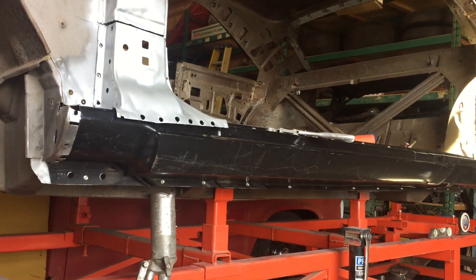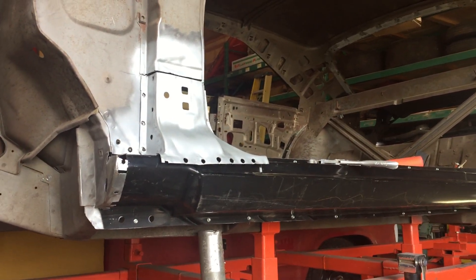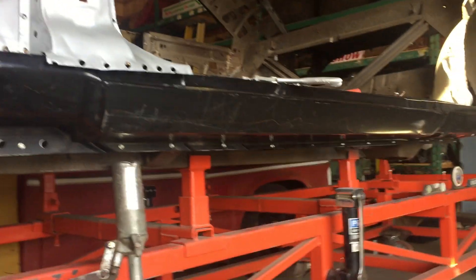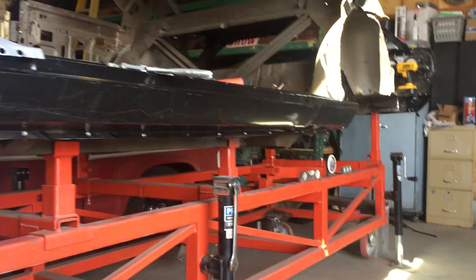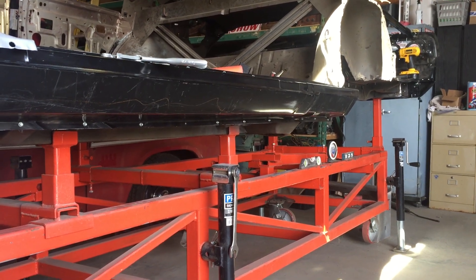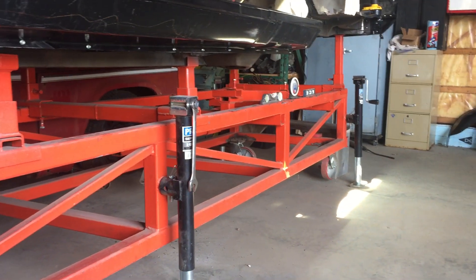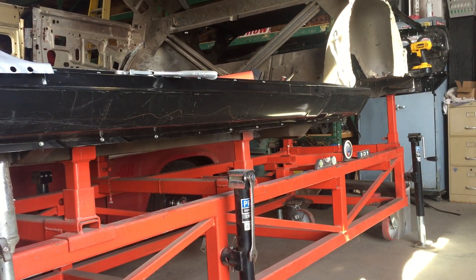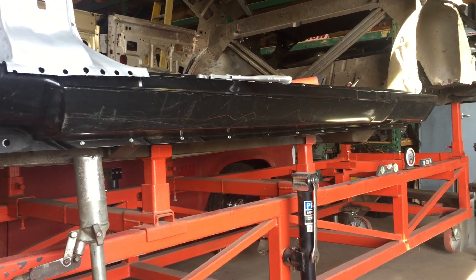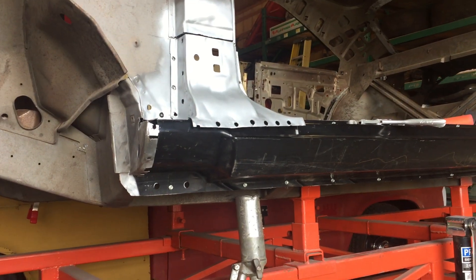Back to the rocker panel — I decided I was going to take the rockers off and put new ones on. Nobody likes this job, and I understand why, but it had to be done. That's the reason I built this jig — it supports the body on all the various points specified in the Mopar service manual for a 1968 Charger. I built these jacks to level it up and I have levels on there. This side is completely level, same as the other side, and it allowed me to get this rocker panel on there perfectly level. Even so, it didn't fit the first time — I had to make it fit with a two-by-four and a sledgehammer.